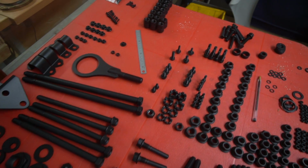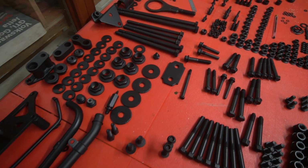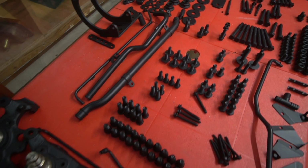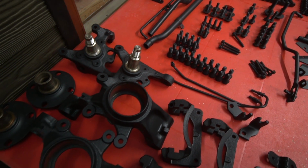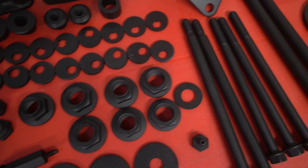Now Xylan coating is basically a very thin film coating that's extremely tough, that is ideal for use on components where you've got a mated finish that's bolted and you don't want any give in the material. You often find with painted or powder coated finish, when you bolt the components together, if there's still paint or powder coat on the mating faces, it compresses over time and the bolts actually go loose.